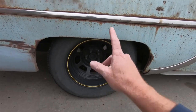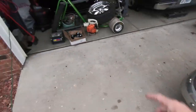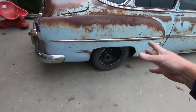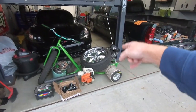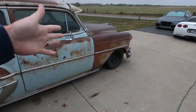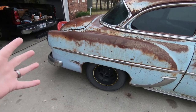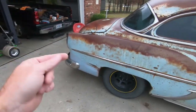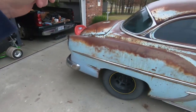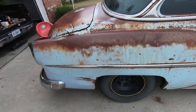There are two options here, and I'm going to exercise one that's not my favorite, but it's the easiest way to do it right now. Down the road, I think I'll put a different rear end in this thing, but we are going to be using adapters, or spacers as they call them. These actually bolt on — they're not ones that are just plates. We obviously have some new wheels stacked up right here. I also took the wheel off of my old truck — this is a 20-inch torque thrust, 20 by 8 — and I test-fitted it so I could get an idea. I knew what size I needed in the front, and I also test-fitted it in the rear. The only way I could do that was to set it up on a block, have my son help me hold it, and then try to measure for spacer size. According to what I've calculated, that's a 2.5-inch spacer, which I know is big, but I'm pretty sure we're going to need to be between a 2.5 and a 3-inch spacer. So I ordered 2.5.